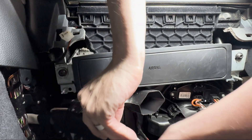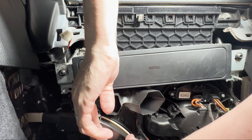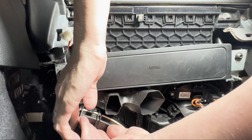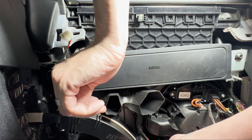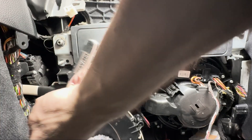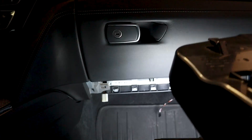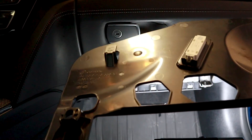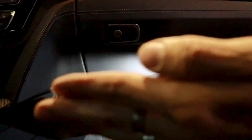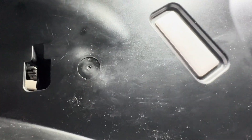New air filter in — just snap this back in place. Make sure you hear that snap here and then back here when you push this back on, and then put your T20s back in. With these screws and with the bolts, there's no torque spec — just tighten them until they're snug. First panel's back in. Now take the other panel, angle it like this where this front bar is in front here, and first things first, reconnect your wires.